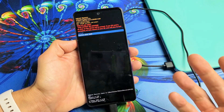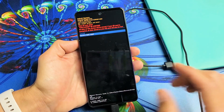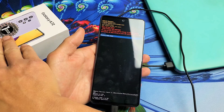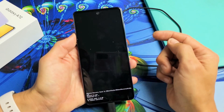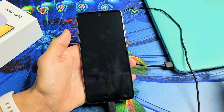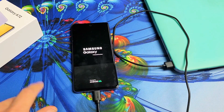It'll take about one to two minutes, then after it boots back up you'll be on the beginning setup process — choosing your language, pretty much as if you just bought it brand new out of the box. I'm not going to factory reset this phone, so I'll go back up to cancel, select that, then reboot system now. Pretty simple — questions or issues, comment below.